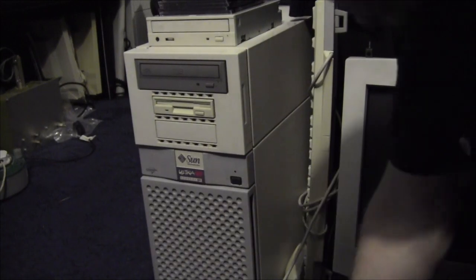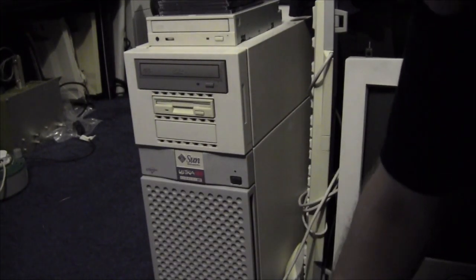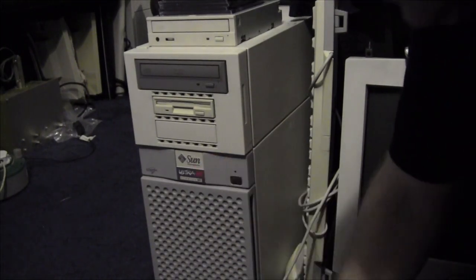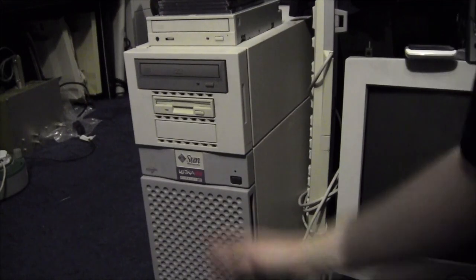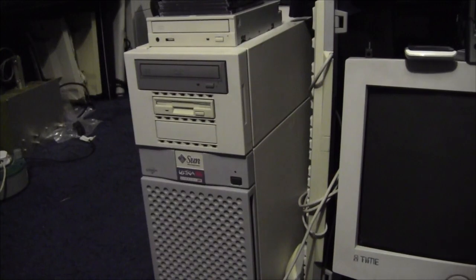So, thinking that possibly the hard drive needs a reformat, Rob slipped in one of his spare hard drives, because you're talking apparently about 7 to 9 hours, if not more, to format the drive on one of these. So we put that one in, we tried the same process, and we came up with the same trap E3. And each time, obviously, it complained that the EEPROM battery is dead.